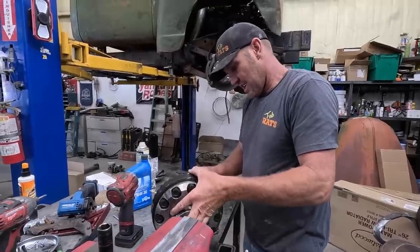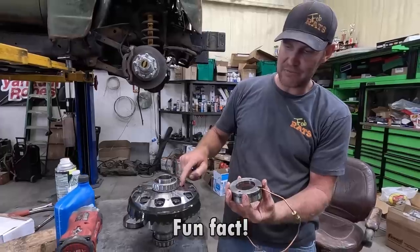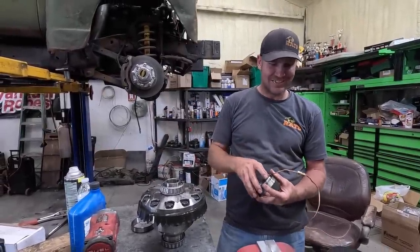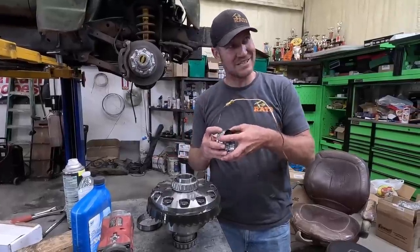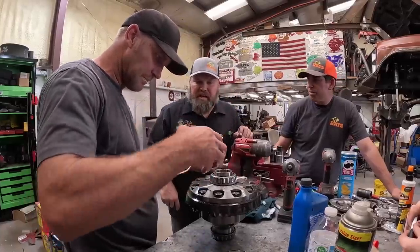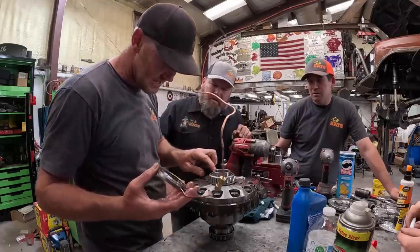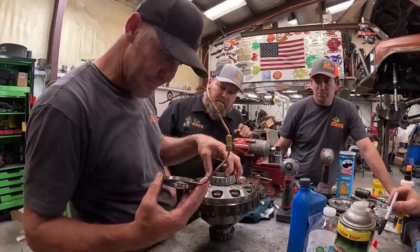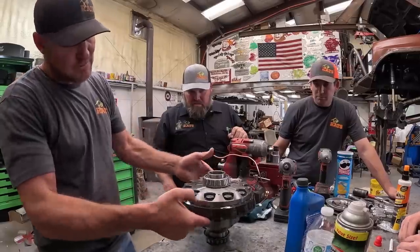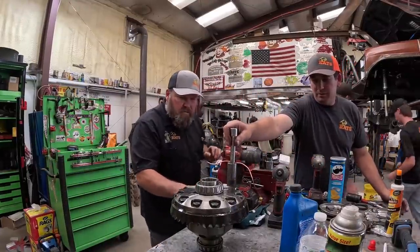Okay! That's heavy. So the 14 bolt, this sets on the other side of the bearing. And you gotta put a puller underneath of here and here to pull it all off. Never done that. It's a pain. I'm trying to decide if we put new seals on this while we've got it out. Or was it the line going around in there? No, it's rubbing. It's thrashed this and that. Wow. We're gonna have to get to the bottom of that. Need some sort of a spacer setting down in that. Guess we can pull the ring gear bolts and drop it, pull the pinion, and then away we go. Back together and we'll figure that out as we go.